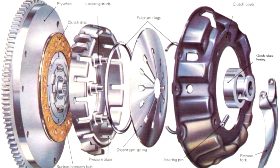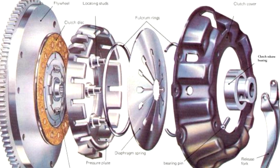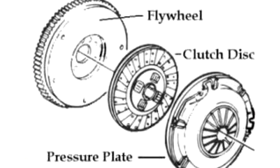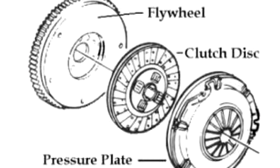Once you have preloaded, now go for the gear change. Throttle down, pull in the clutch, shift the gear, and release the clutch gradually along with throttling up. I'm sure you will notice a far smoother upshift with this preloading over when you didn't. This works well especially when you are upshifting. While downshifting the gears, there isn't much necessity for preloading.